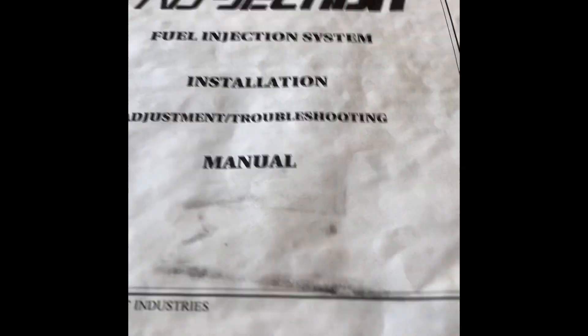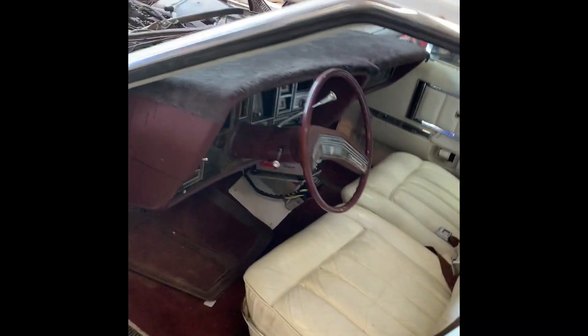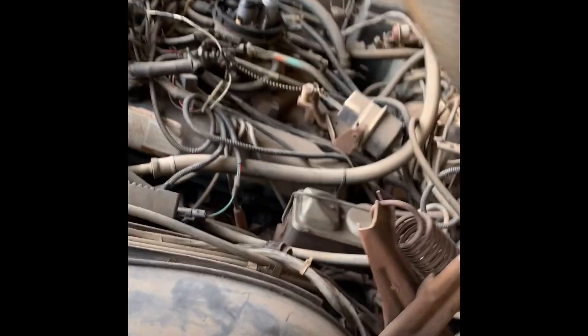Here's that new sending unit. So I'm going to be picking her up, dropping the tank, putting that sending unit in there, and then checking this system out. Since him taking off from Brownwood to Midland, he has encountered another problem — above half throttle it has no juice, no get up and go, doesn't want to move out of its own way. So I'll be checking into those and hopefully posting it as a video.